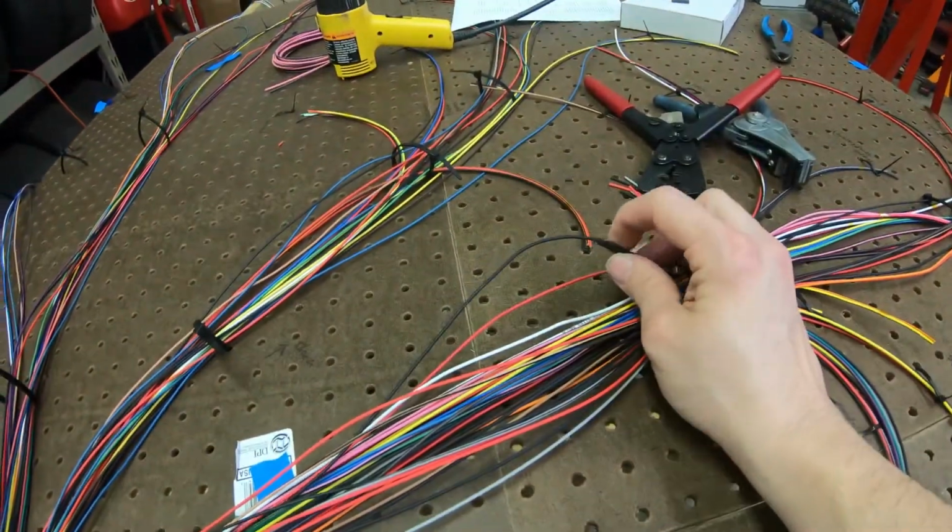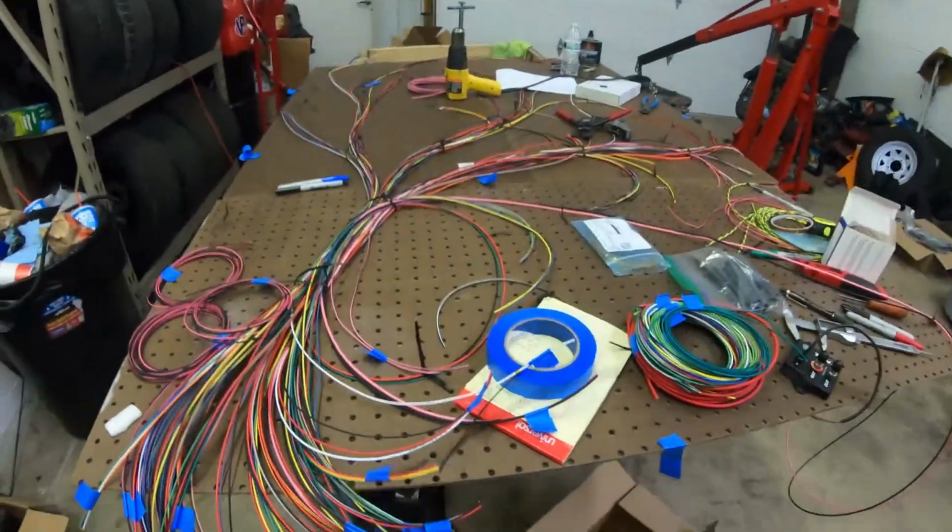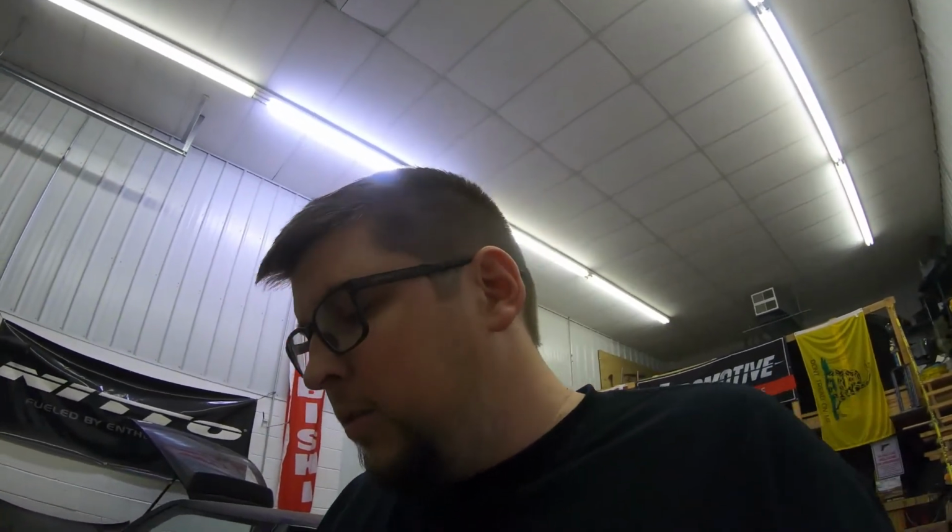All right, so got the ground blend done. One thing I did want to touch on is the extra wire. That'll be getting pulled out, because it's no longer needed. They'll be both blended in, and they go to the same pin on the ECU. They've got the same sensor ground and 5-volt reference that go to the ECM. So I don't need two of them, obviously, so just have the one. I'll pull out the old wire and just save it for later.